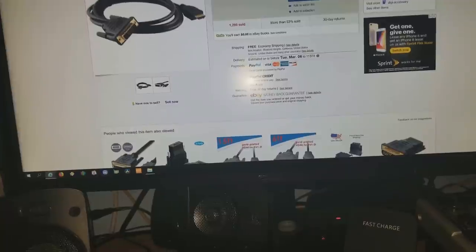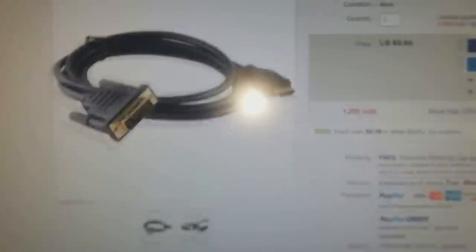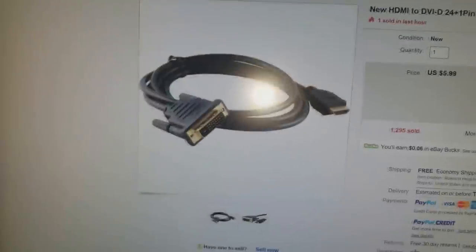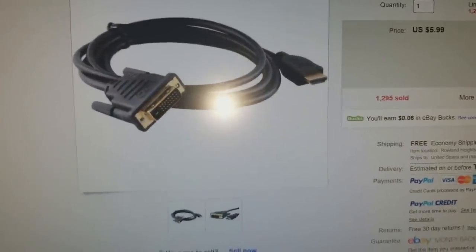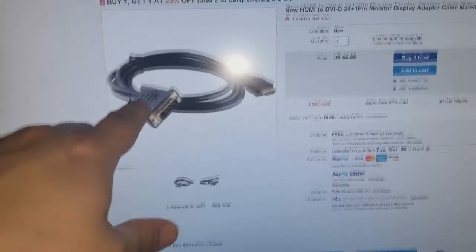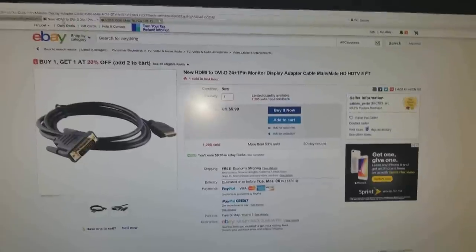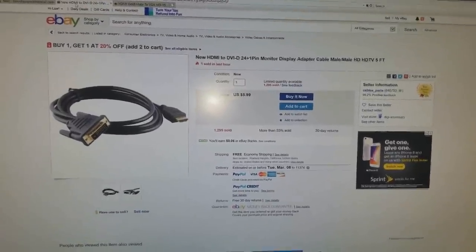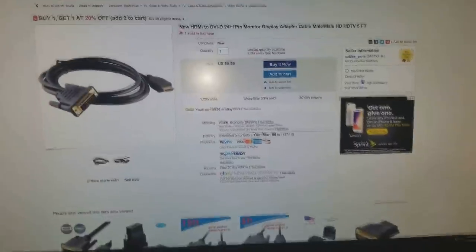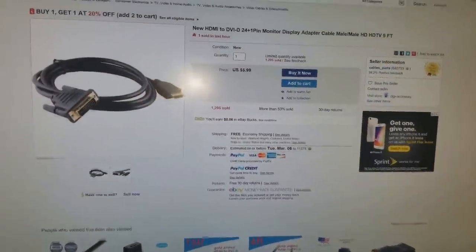Now let's say you have an older monitor. You just get yourself one of these — it's on eBay, I'm not endorsing anyone, just get the cheapest one. You get yourself an HDMI to DVI cable. The HDMI end hooks up to the dock and the DVI end hooks up directly into your monitor. You do NOT want to hook this up to your computer — hook it directly to the monitor. Even if screen-capture software made it possible, it would still drain your computer and you wouldn't be able to play it flawlessly.